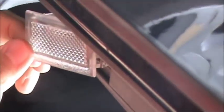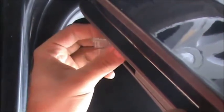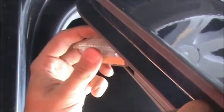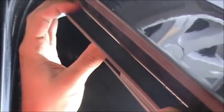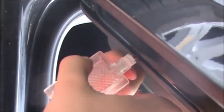Now that your door panel should be loose, put your fingers into the top part and press down on the pins that hold the light in place — your light should pop out just like that. Next, maneuver the light outwards so it can go into the door panel and you'll have access to it outside when you pull it through the crack. Try different angles because there's a certain angle that works better. So now my light's in the door panel. Detach the light — you'll see there's a little pin here, press on that and pull the light out.